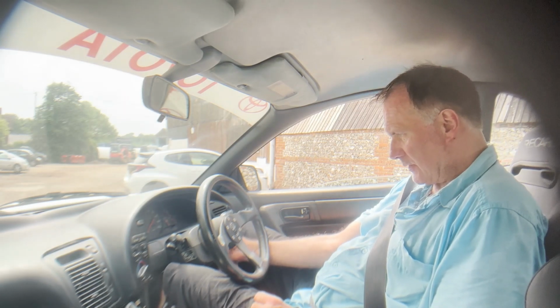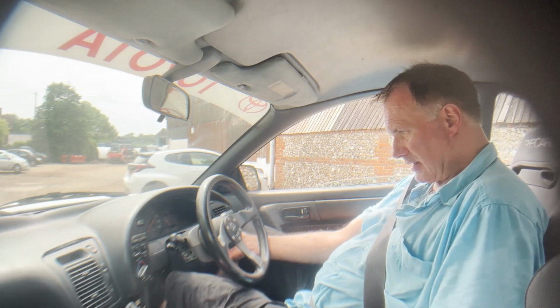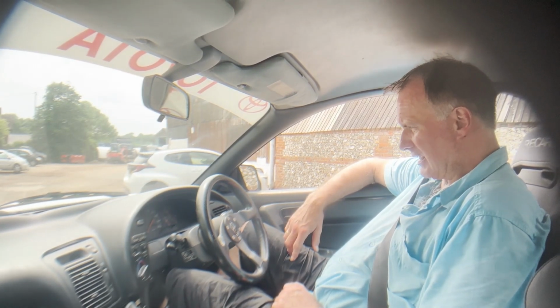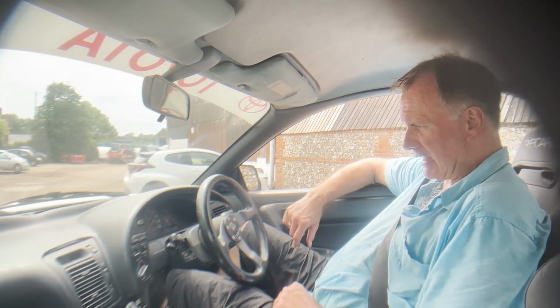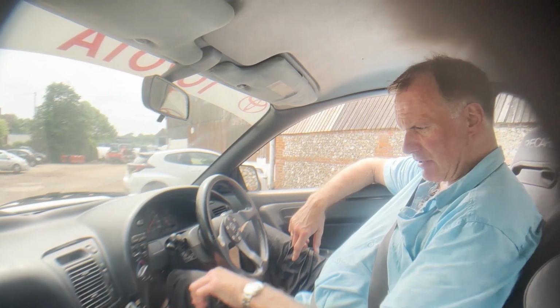Okay, let's take this 1989 Toyota Celica GT4 ST185 for a spin. All lights, ignition light and stuff come up as they should. Starts nice. It starts really well, this one, hot or cold. I did use it this morning, so it's not stone cold, but it's not especially warm, should we say, at the moment. One thing to note, because it's had a different ECU put in it, the original boost gauge and temperature gauge are no longer connected. However, it has got boost gauge, temperature gauge and oil pressure gauge down here in the center console, which all work properly.